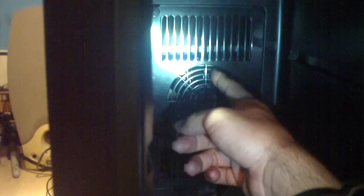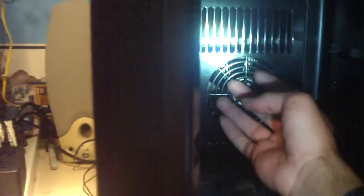But this right here circulates the air inside the fridge. It sucks in air through here, pulls it across this cold side heatsink, and blows it through here, and does the same thing through this side too. And it even has a little drain down here. I don't know if you can see or not, but there's a little bitty drain down there. And the outlet is on the outside of the fridge, and I'd have to hook up, let's say, a piece of vinyl tubing and run it to, let's say, a pan or something to collect the water. But anyways, all I gotta do is get this thing working. This will make a pretty nice fridge.